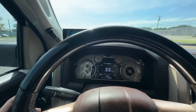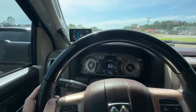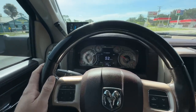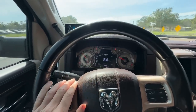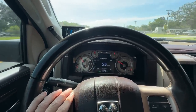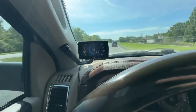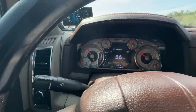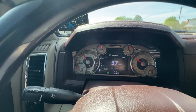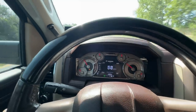Yeah, that was like a little 20% throttle acceleration. The only thing with these diesel trucks is you think you're at 10 to 20% and then you try to give it more and realize that you're all in. But that was only like 10, 15 pounds of boost, so still not working her very hard. Yeah, it's cruising. I have it locked down to fifth gear, because if I let it go, it'll be in sixth gear right now at like 1200 RPM. So we're at 1750, which is kind of the minimum you want to be at to really start getting on it.